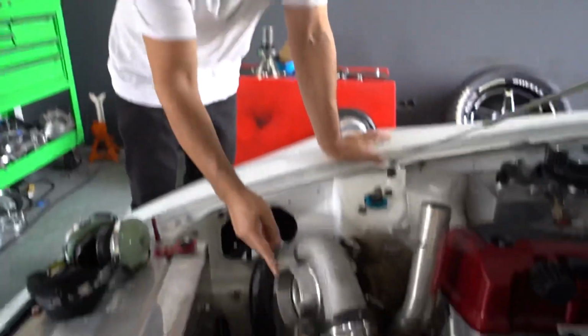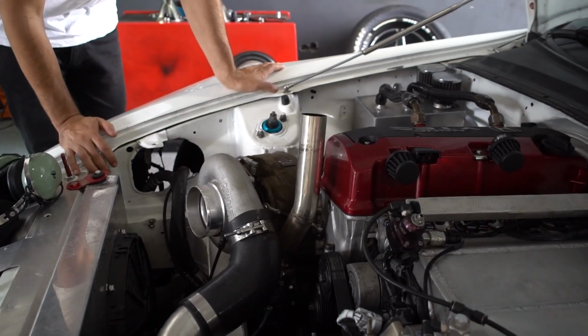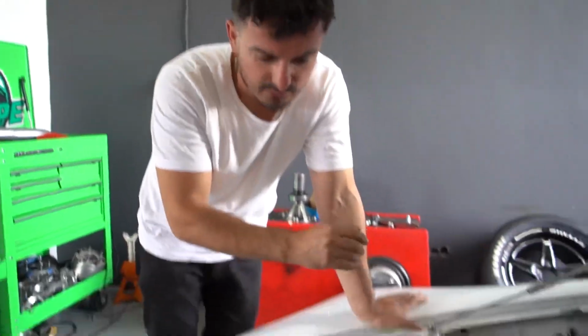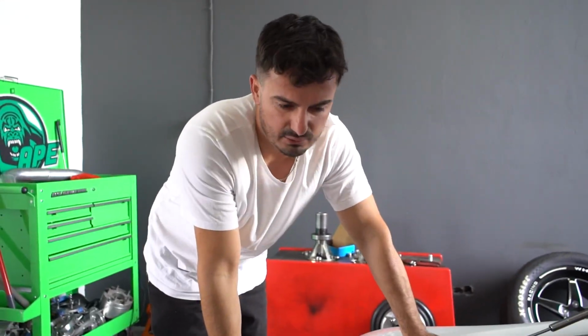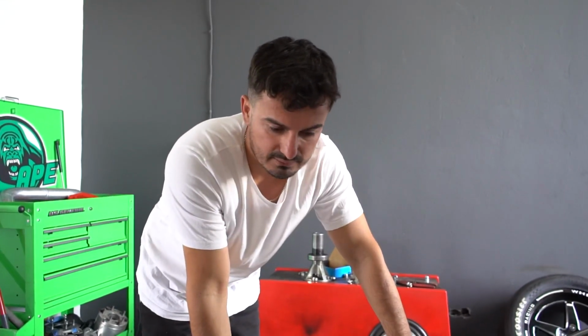If you put in 20 pounds and change the AR, because right now it's making like 700 foot-pounds of torque. It's a lot of torque, so we don't care about torque. Get rid of that torque peak and then it'll just carry the power all the way up top. The good thing is right now you don't have to rev it that high. You just go up to 9 grand and she'll fly.